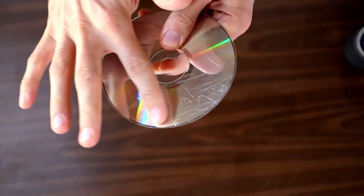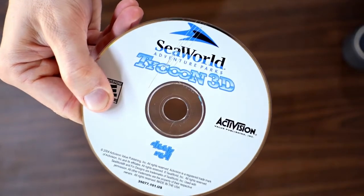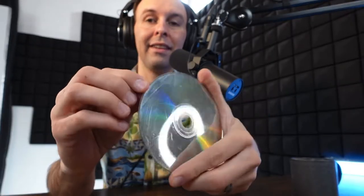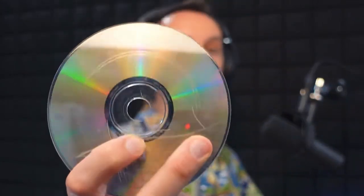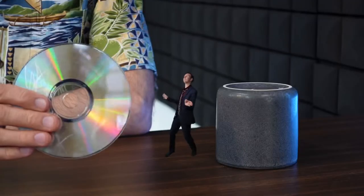What can go wrong with games? The biggest thing is scratches. Make sure it's not too scratched to play — take a good look at the bottom of the disc. If it's all scratched up, it's probably not going to play. Some discs can be repaired but it's always iffy. I prefer discs not in need of repair. The bottom side is the only side that can be repaired because it is thick protective plastic. The label side has the data layer, and once that side is scratched, the data is gone — there's no way to fix it. If you see a cracked CD, that's a pass. Disc delamination — the layers of the disc starting to separate — also cannot be repaired. Ring-shaped scratches mean it was scratched while playing, most commonly caused by moving the console while the disc spins. These are usually very deep and very difficult to repair — nine out of ten times, they're toast.